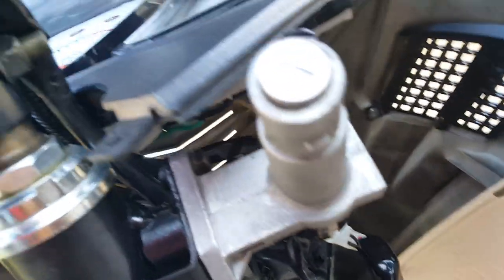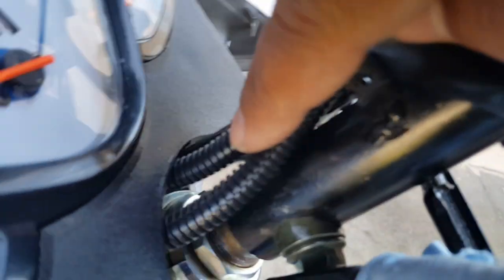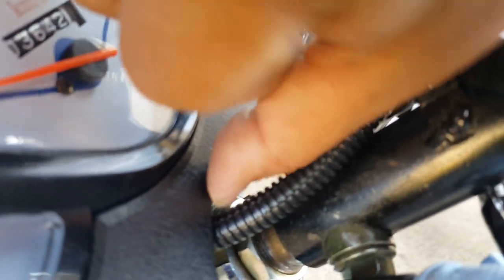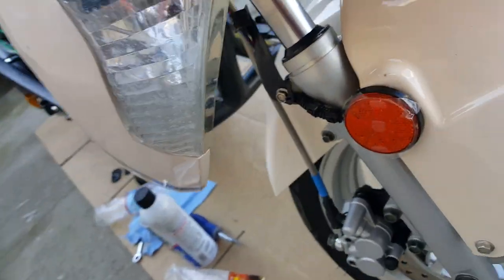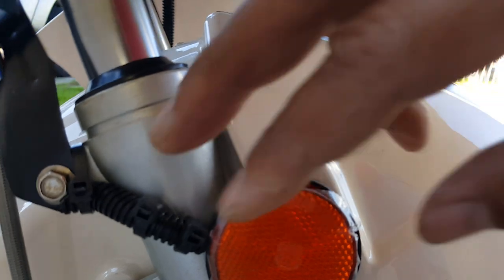If we see any sign of a drip, we're going to replace this whole rear brake line — which I don't really want to do because then I have to re-strap everything. You can see here everything's nicely tucked. Also, I added some wire protectors here because I didn't want my brake line rubbing on the housing since these plastic edges get pretty sharp. You can buy a little bit of these wire protectors and put them in. We also protected some of the exposed wires from our LED lights — we went ahead and siliconed that in. That's been about two weeks too and should be cured.